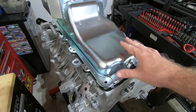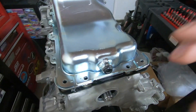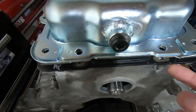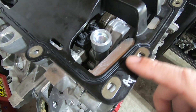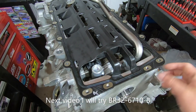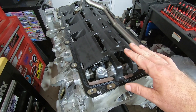When I was test fitting and checking the pickup tube clearance, I noticed the holes weren't lining up on the front for this oil pan. I got a timing chain cover to confirm — and they don't line up. You can see these holes don't line up anywhere close to where they need to be. You could still run this windage tray but you wouldn't be able to get the front bolts on. The pan with RTV would probably hold it, but this isn't my engine so I can't go any further with this right now.